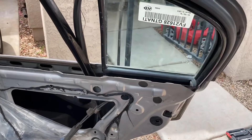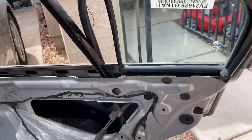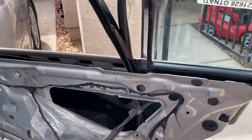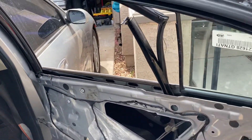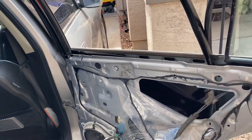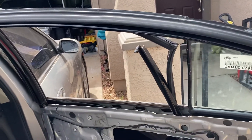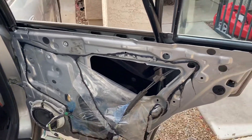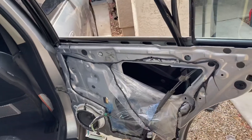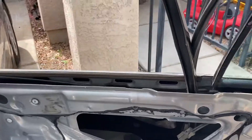As far as getting to the window — this one was smashed out — I just pulled the rubber piece off the side where it used to sit around the window. My trouble almost came up here because I assumed I'd need a motor for this window since it didn't go down. But I tried it and it seems like it was just the driver switch. You'll want to have your window down when you do this.